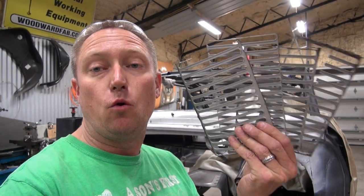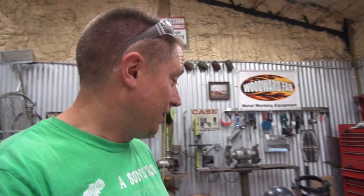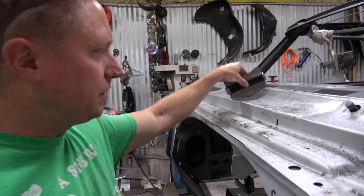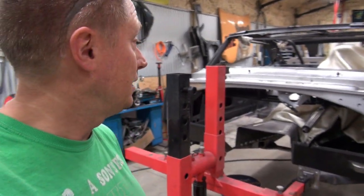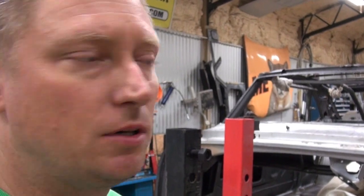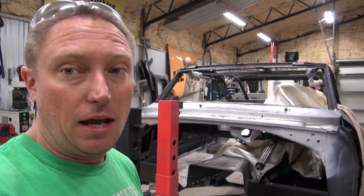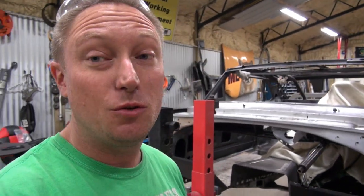That is it. All four of these things are now cut out of the cowl and everything has been walled off nice and smooth. I'm not going to lie — my sheet metal work is not that good. If I take my contour tool and set it over here and slide it down over to here, you'll notice the contour really isn't quite right — there's a little gap at the top and bottom, which tells me I've got some hammer and dolly work to do. But the meat and taters of all the fabricating is over. I'm afraid to even wonder how much body filler it's going to take. I'm hoping for a sixteenth of an inch — I'm afraid it'll be a quarter. If it's an eighth or less, I will consider this a huge success considering I've never done this before.